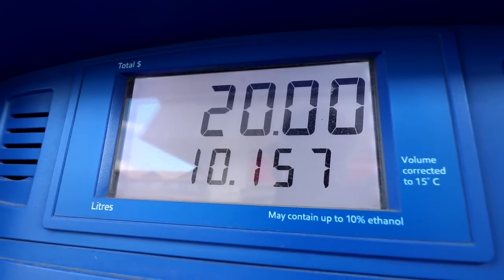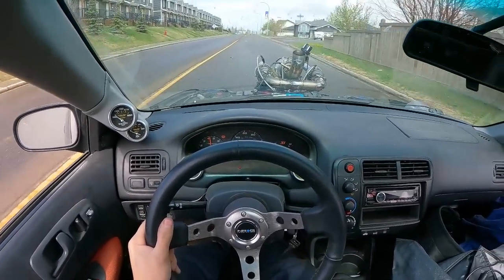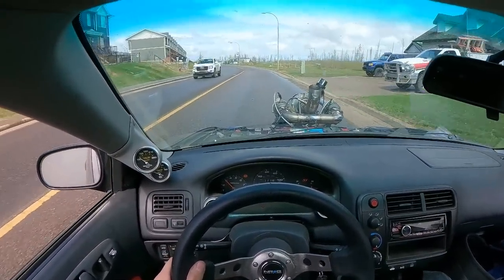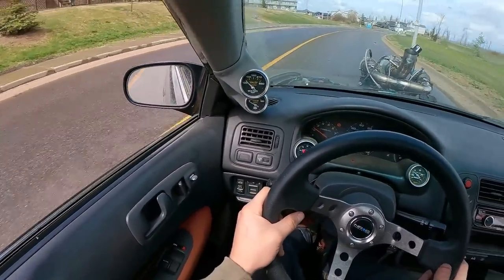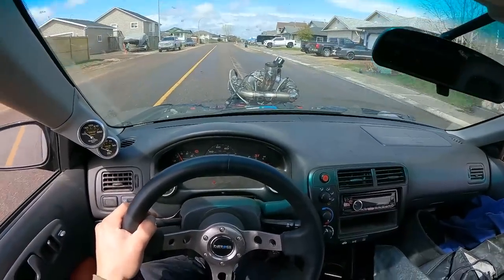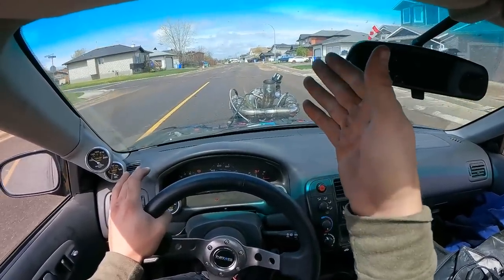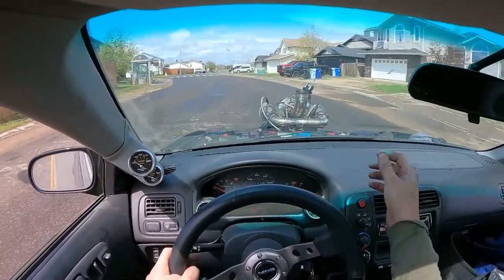For the record, you only get 10 liters for 20 bucks in Canada. It makes like 10 pounds of boost. It's hitting some sort of cut though. So Adam, please, I need you to tune this thing. In gear. It made like 8 pounds of boost by like 4,500 RPM and this thing revs to 82. So the compound is definitely better than the quad turbo were. That wastegate clamp might not be tight either because it's starting to clock a little bit.